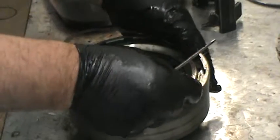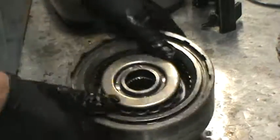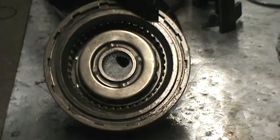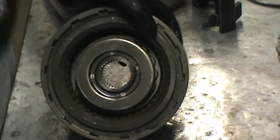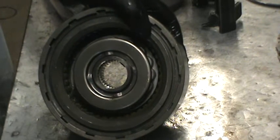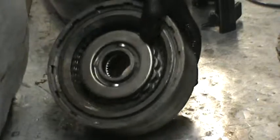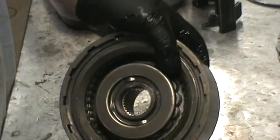We're going to put the clip on here. Okay, here we go. This is going to spin, but it's going to spin very stiff. Now in a street vehicle, like a daily driven vehicle or a big tuna boat back in the day, this is how they came. They would break themselves in and last for 100,000 miles or longer. But it is a little bit tight. Would I do this for anything other than a restoration or a tow truck? Probably not. But this is the way it would have come in this drum with this piston right out of the factory. These are aftermarket clutch discs and aftermarket steels going into a drum that's 40 years old. If you want to do it this way, this is how it's supposed to be done according to the manufacturer and the ATSG book. I think it's too tight.